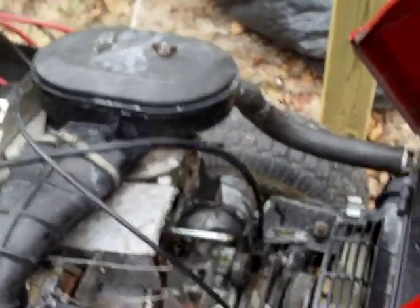Okay, the water pump is working — a whole bunch of water just came out through that hole right there. So the water pump is definitely working. I think that thermostat is stuck, pardon my French. I've gotta get this apart.